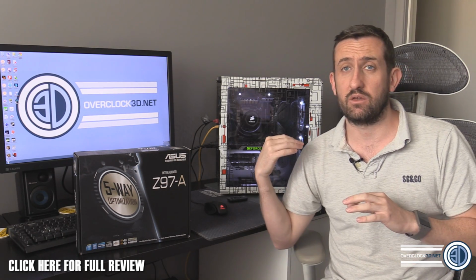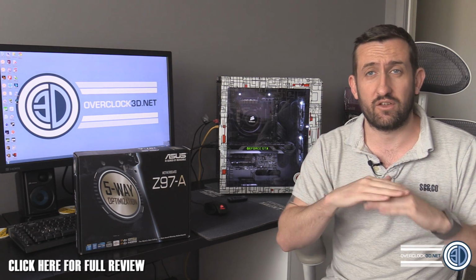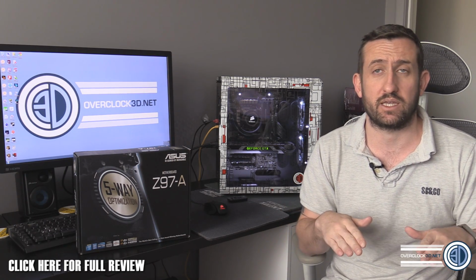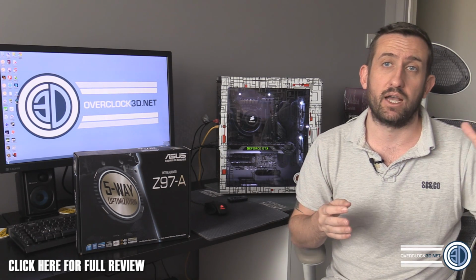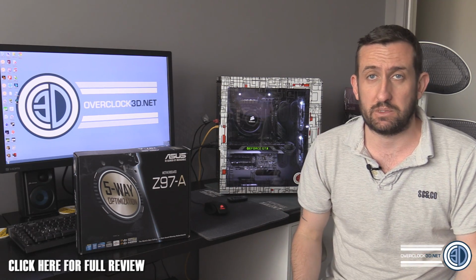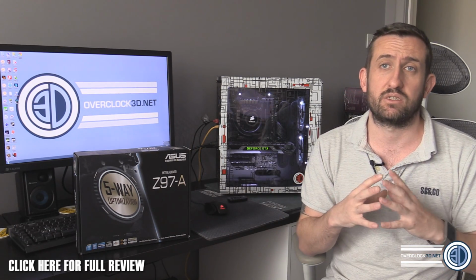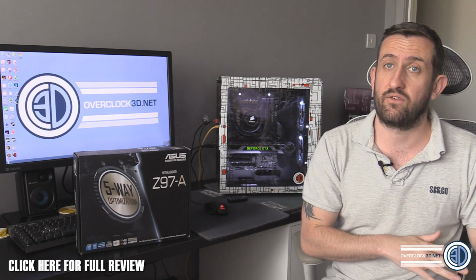And with this CPU, we've got a nice starting point, or at least our level off point was 1.26 volts and a 4.9 gigahertz overclock. We probably will go back to stock and overclocked when we get the new CPUs, but at the moment we're essentially having to do something which we wouldn't normally do, and that's test the old CPU on a new board, and we know we're going to have to go back and do it again. We've just minimised the tests down, and we'll probably reintroduce the stock stuff later on.